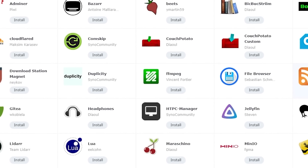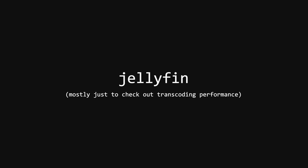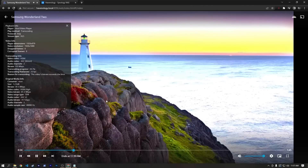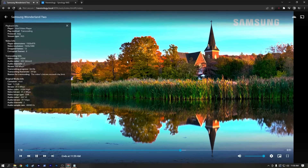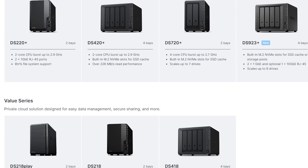If you're looking to do something that Synology doesn't have a package for and don't want to use Docker, you can add sources for community-made packages for more options, which is what I did to install Jellyfin. Jellyfin is great for streaming your personal media collection, but when I tried transcoding some 4K footage down to a lower resolution and bitrate, the R1600 was absolutely slammed. This is once again due to the lack of hardware transcoding. If you use a different Synology model, it most likely has hardware transcoding available, which won't impact performance nearly as much.